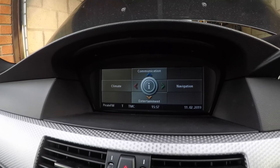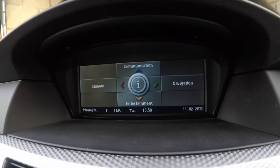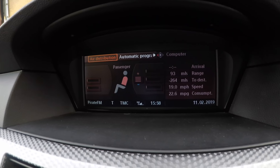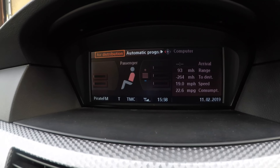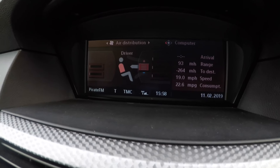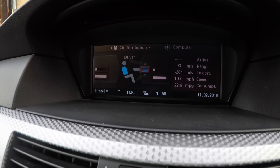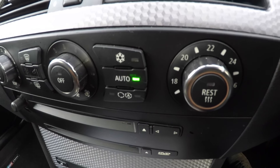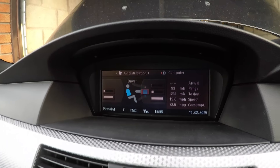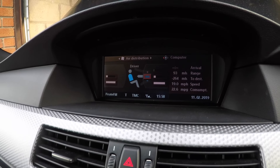So now I'm in the iDrive — you're probably wondering why I'm in the iDrive for air conditioning, but I'll show you why. If you have widescreen iDrive like I do, you'll see a 'Climate' option — you need to go to that. When I bought my e60 I sat there for nearly an hour figuring out why the aircon wasn't coming out cold. As you can see here, this is set to hot. What you have to do is manually scroll down to the cold setting, so all your air output is cold. If you just set it on the dials without changing this, it will not work. Even if you set it to 22 or 23 degrees on the dial, you'll still get hot air unless you change it here in the iDrive climate system.